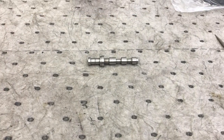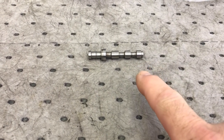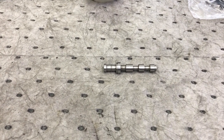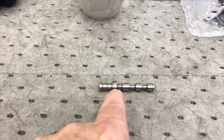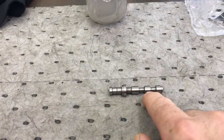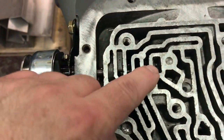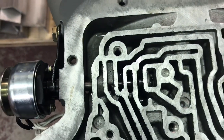Good morning — it's a new day. It got late last night and I was frustrated because the first valve I modified, about every fifth or sixth time you shove the brake valve in, it would stick in its bore. So this morning I took a different valve, cleaned and polished it, tried it in the bore, and then made both modifications as the instructions specify — you have to do two mods to the valve. Now I have confidence that every time I push it all the way in, it returns. Before, it would be fine until partway through, then stick. Don't quit until it functions every time — otherwise you'll just be working on it in the car.